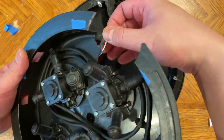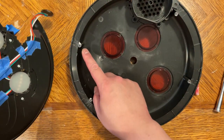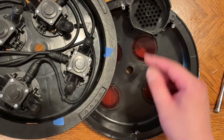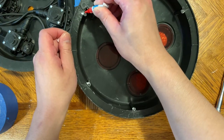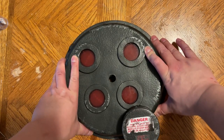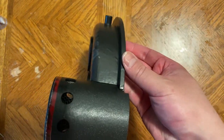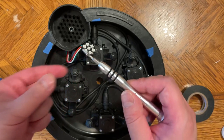Once you're good to go, glue it back on. There are several ways to secure the two lid pieces back together — Dustin suggested drilling a hole through the pegs and connecting with screws, or you can just put some glue on and re-glue it back together. I glued it with super glue on the six pegs, held it down pushing on the edges until it bonded. It holds up well — strong enough to hold together but not too strong that you can't pry it apart if you need to get back in. Don't forget the two screws.